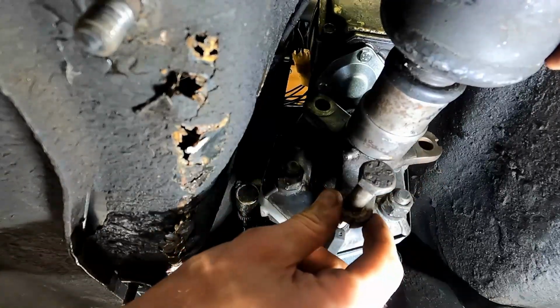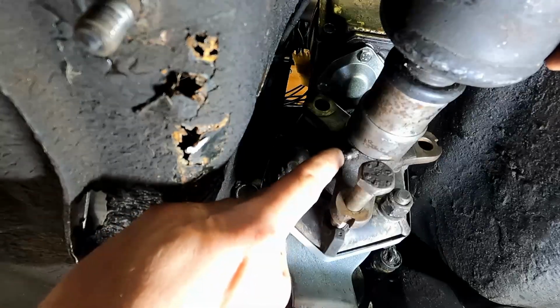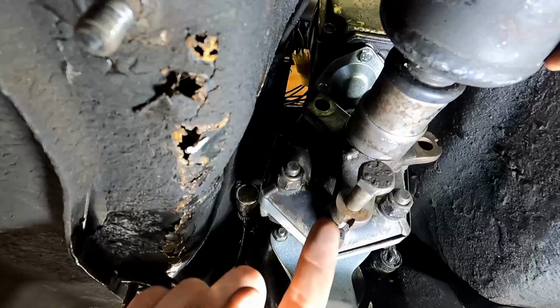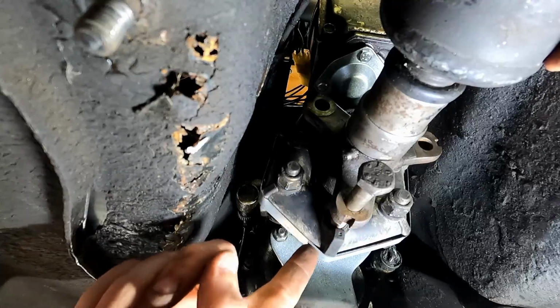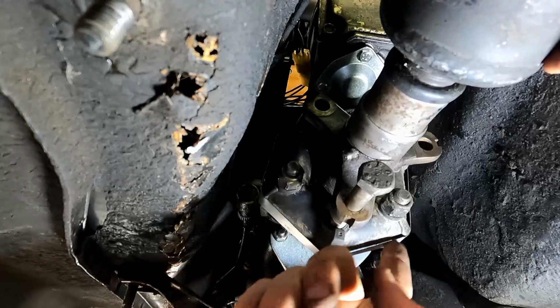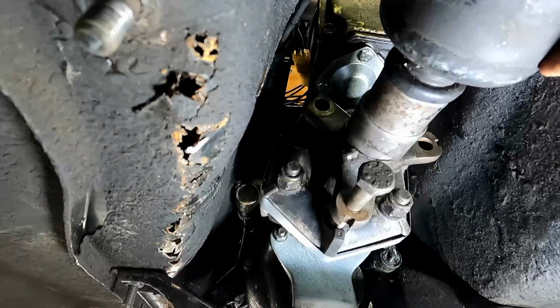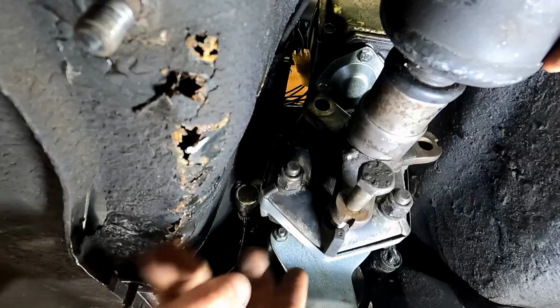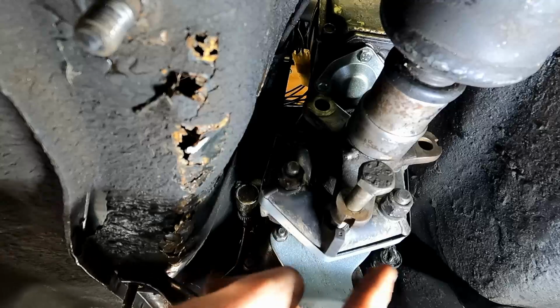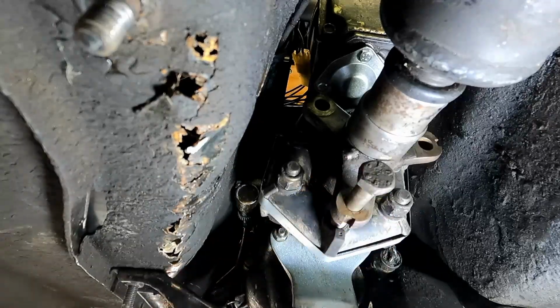And before we wrap up, we'll definitely make sure to grease it here on our grease fitting, and tighten up our carrier bearing bolts, make sure those are nice and tight, and then finally cut this metal band here. You do not want that exploding on you down the road, because it'll be one massive bang. So we definitely want to make sure we get that taken care of too. So it's not really exciting, but we're just going to suck these down and get this straightened out.